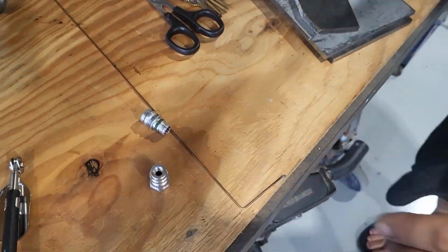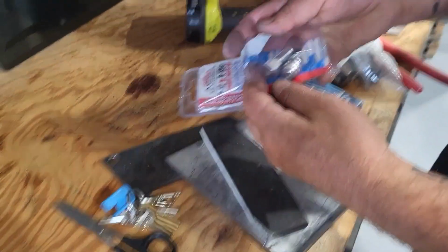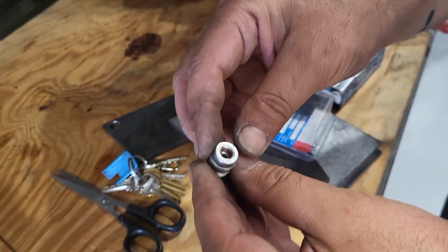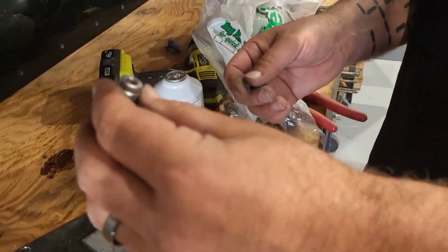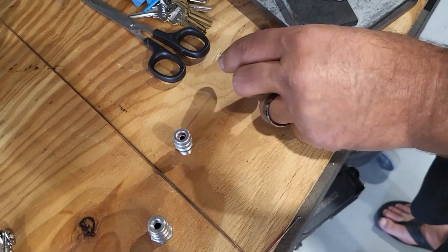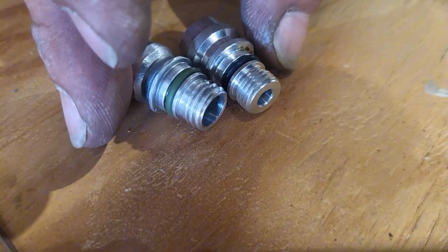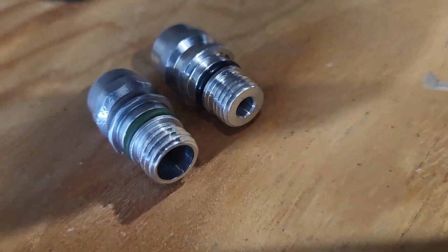All right. Okay, are we on? Yes. So, this is our original high pressure port. I needed to plug into the high pressure port so we could ascertain the health of the air conditioning system. That's like a critical thing, right? And it'll also help in diagnosing. Anyway, this fitting is bad, leaking, and it was filled full of epoxy and stuff from the last guy. So we went and bought another fitting, which looks to be exact, but it is not. Can you even tell? The thread sizes are different and the O-ring sizes are different, so this new one will not work.